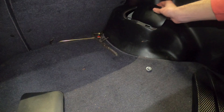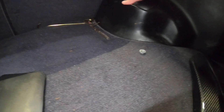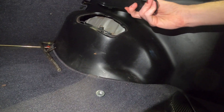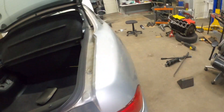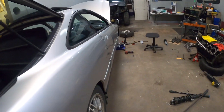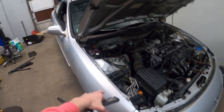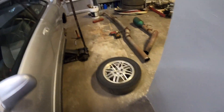Setting it to 12 means it's not going to be super bouncy or super stiff. Obviously if you're really a race car driver you'd already know that stuff, but in case you don't, you just adjust it over time and take it for a drive to see how it feels. I think in the back you want the dampening to be a little bit higher than in the front, but I'm putting 12 on each corner - 12 on all four. Probably never going to touch it unless I notice it's super bouncy.